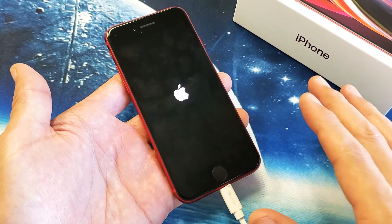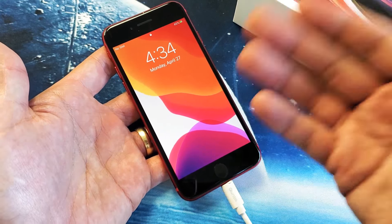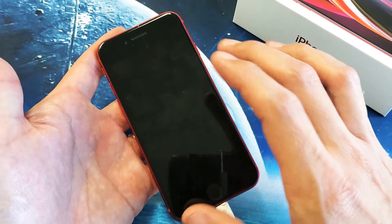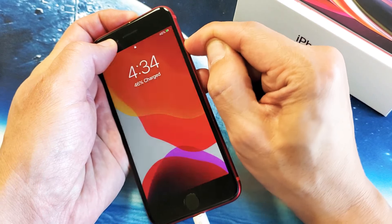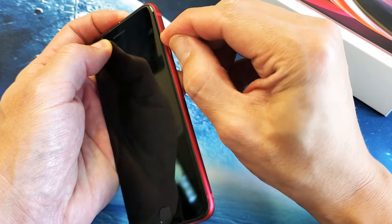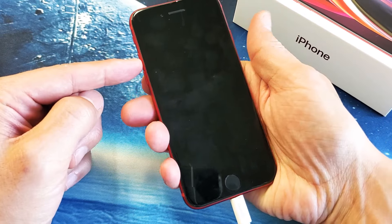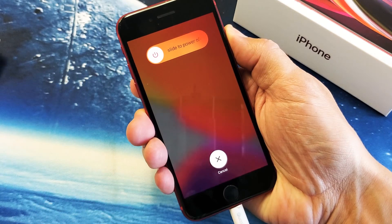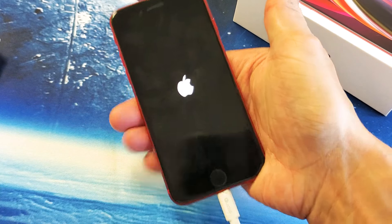If it's still a black screen, keep the lightning cable plugged in. There's a possibility that if your power button is loose, jammed, or stuck, it'll keep the screen black. With the phone plugged in, press the power button in and out — try to loosen it up. Press it maybe 30 to 40 times. Then do the force reboot again: volume up, volume down, press and hold the power button until you see the Apple logo, then let go.